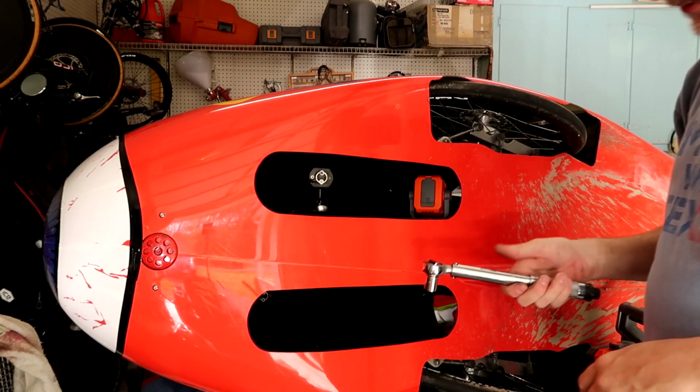There we go. Whew. That is a lot of torque on an inch wrench. Obviously if my torque arm was longer, it would be easier to put 35 foot-pounds as opposed to 420 inch-pounds. Still, got it locked on, 35 to 38 foot-pounds, which is 50 to 55 newton meters of torque, and hopefully that will keep it locked in place. Now I'll get the button installed and take it out for a quick test drive, and we'll see how it works.